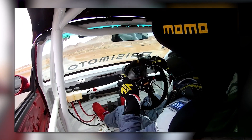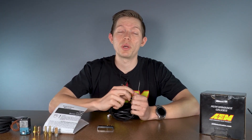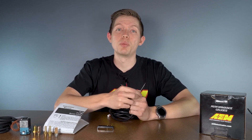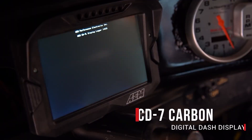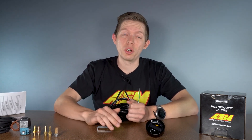The gray boost safe wire is a low-side output that will trigger in the event of an overboost situation. This could have your ECU switch to a different run mode if you have that capability, or you could have it trigger something like a warning light on the dash, or even your windshield wipers to come on — just to let you know you probably want to back off a bit. The CAN high and CAN low are great if you want to data log information from your TrueBoost gauge, including overboost events, commanded boost duty, whether you're on run mode A or B, current boost level, max boost, and many more.